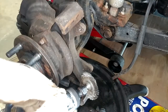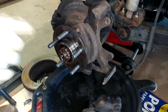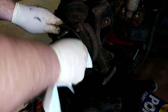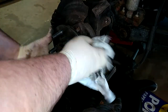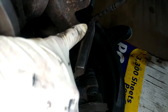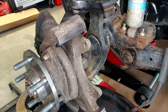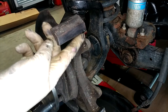I'm going to touch these up with the wire wheel - not a very aggressive one, just to kind of polish them, they're just a little rustier than I'd like. It is important to keep these faces clean so you don't warp your rotors. If there's crud here and you tighten it down, it'll pull your rotor in a way you don't want. Also make sure you get around this flange because the hat sits down over that. There is considerably more wear on the knuckle assembly - you can see it's got a dish where the pads have been riding on it. The fix is to replace these knuckle assemblies, and they're like $400 a piece.